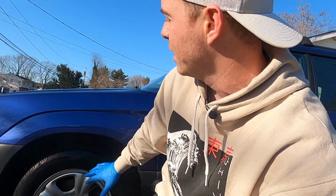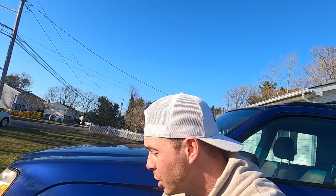All right, guys, so that's it for this episode. Wheel and tire cleaning, episode 3 of the Forester detailing series is a wrap. All right, you guys have seen how to clean the wheels using a basic all-in-one wheel and tire cleaner and just 1 or 2 brushes. And you've also seen a much more detailed approach using iron removers and targeting those iron deposits, coming in with a wheel cleaner, some more detailed brushes, softer ones for wheels on the faces, and stiffer ones for the tires and the rubber, the long-handled one for getting in the fender wells, and that small Worx detailing brush for getting around the center caps and the lug nuts.